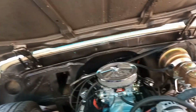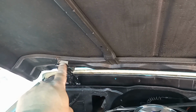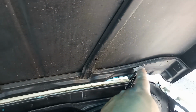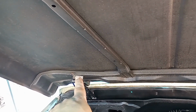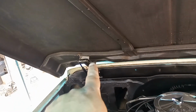It's a crazy world, but it's weldable. I'm gonna weld it. I'm gonna weld that. I'm gonna weld that. That way, since right now they're intact, they're not moving anywhere. I'm gonna weld these out real slow so it doesn't warp anything. I don't want it to bust these little tacks. Let it weld. Let it cool on its own.